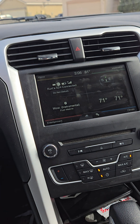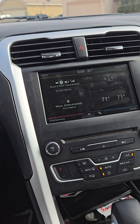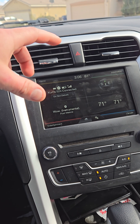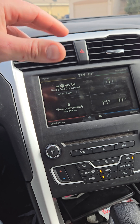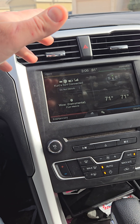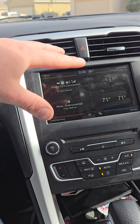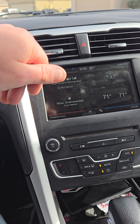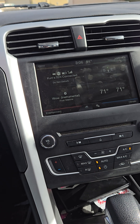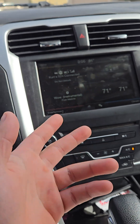What you're going to do is open this up — it's kind of a mess. You pull your APIM, put that T-harness in, pull your radio out, take your APIM off, put your module in, and drill the hole before you put your module in. Take everything apart, take the screen down to its bare materials, open up the module, take everything out of the APIM — which is just your head unit computer — drill the hole in your box, put your modules together, and link the cables.